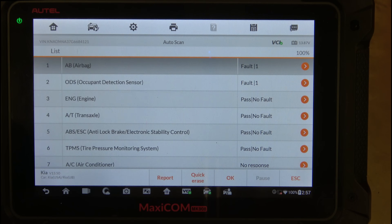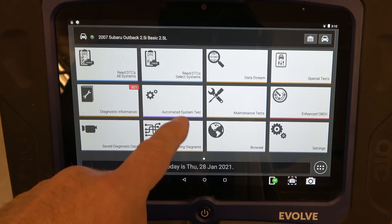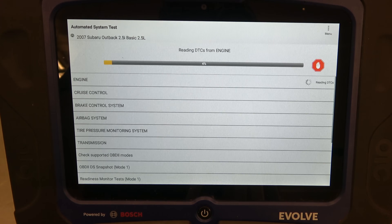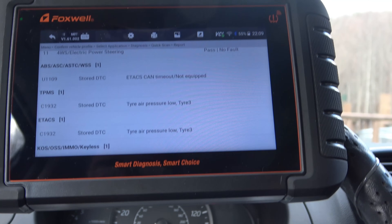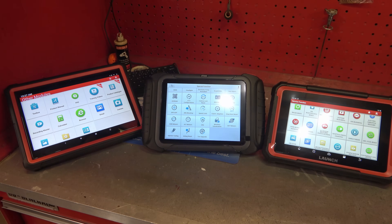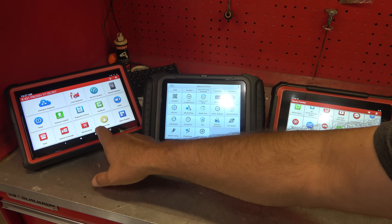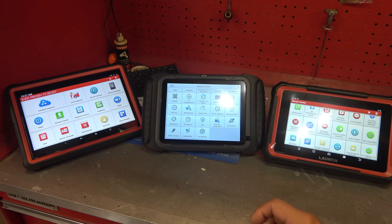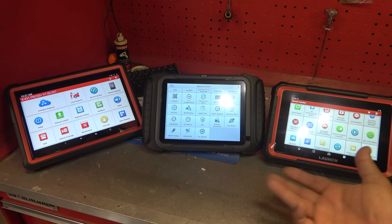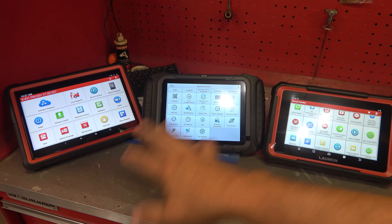For those guys and gals who have been doing this for years, the ability to do all the stuff these pro tools offer is pretty incredible. You're looking at all the different resets, start/stop reset, transport mode, window calibrations, DPF regen — no matter what the make of the scan tool, a lot of these are very similar. I'm a huge fan of Launch products but I've used Autel and X-Tool and several others and been happy with every single one, except one of the newest Autels — there's a video coming out this summer or early fall, and I haven't been that disappointed in a tool since I bought the Zeus. These tools also allow you to run a shop: you can send emails to customers, and some give you shop management features like tracking which tech is working on what.